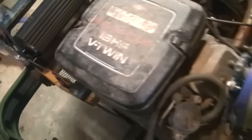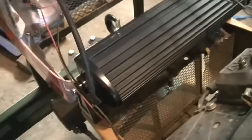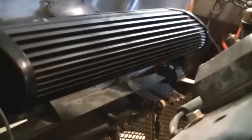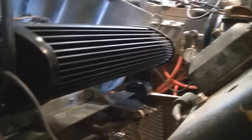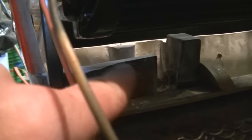Let's get the hood open and have a look at the inside. That's the industrial view — I've got it temporarily wired up to the main headlight circuit. You can see I literally just screwed it to the headlight terminals just to test it. I'll probably put it on a separate switch later. The whole unit is aluminum extrusion with big honking heat sinks on it. The mounting brackets are aluminum as well, which is nice. I just basically bolted it right to the lower cowl section. I had to do a little bit of clearancing here along the bottom edge of the hood and a little notch on the hinges, just to get it as far forward as possible and still have the hood operate properly. I figure I've left myself enough room up here to mount that Delco 12 SI alternator.